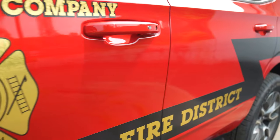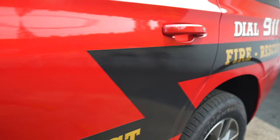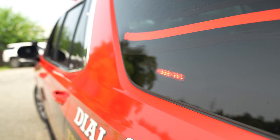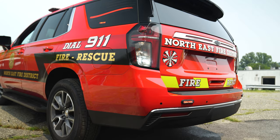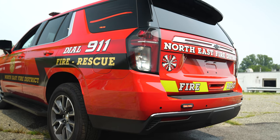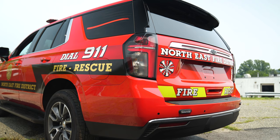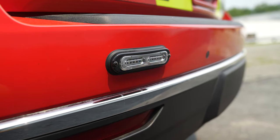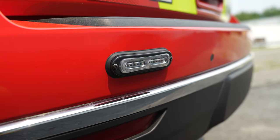You can see our graphics package matching their existing layout, and an Ion Duo in the rear side window. At the rear of the vehicle, we've got our reverse bulb parking light tied into the CORE system to give them control over it — the same way we do on some of our other builds. This provides a great solution for warning without modifying the tail light, avoiding any warranty concerns.